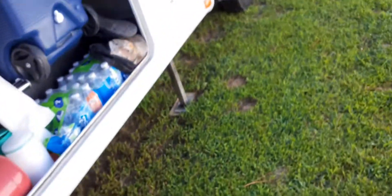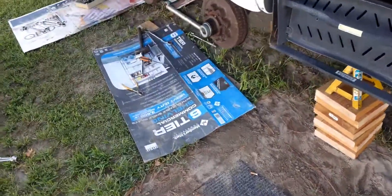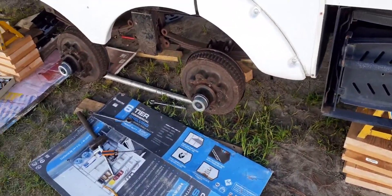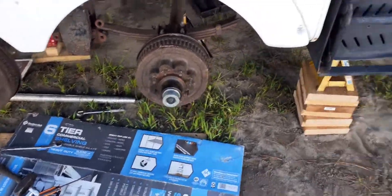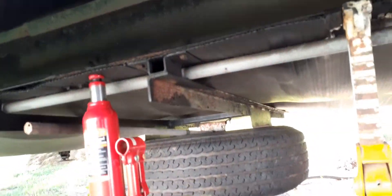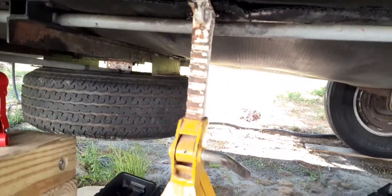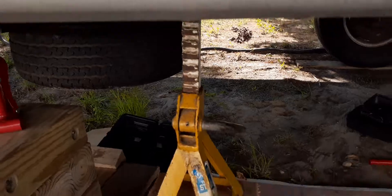The hardest part of this whole thing is jacking the trailer up. I got this leg down, that leg is down, and that leg is shorter so it can pick this side. I have it hooked to the truck just for support — it'll tilt in that hitch but the hitch gives it support along with the legs. I got jack stands there, more jack stands, and the hydraulic pump I left in there — no sense in taking it out — just to give it a little extra brace. It's tipped a little bit, which is one reason I got the truck hooked up to it.